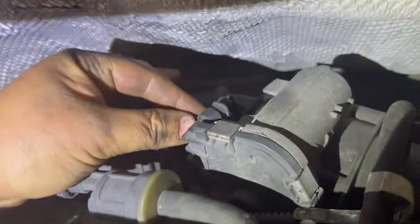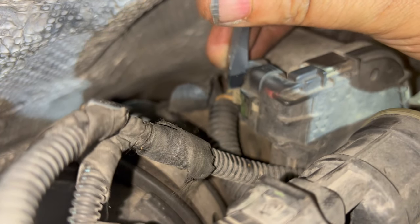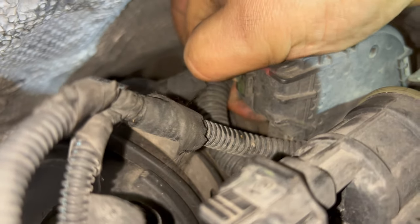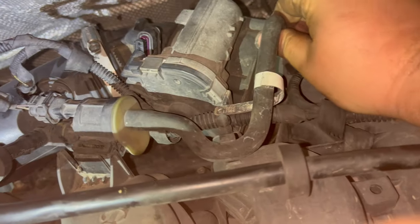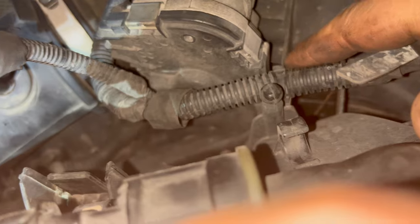The next thing — leaving this small evap solenoid pump in place. The only difficult one is the throttle body connector. It's the motor that controls the butterfly — the wiring to it is a two-stage lock: push it back, squeeze and pull rearward. You may need a screwdriver to assist. The whole assembly just slides onto a little tang. There's also a little vacuum line which should just be hand-releasable. The wiring bundle to the throttle has a little clip that grabs a little thing — you just pull up, it's a V-clip.